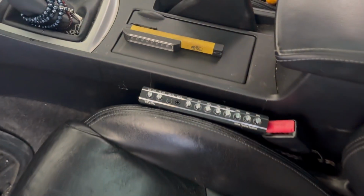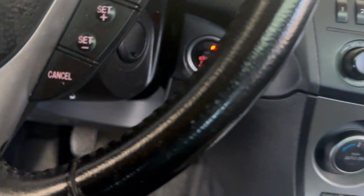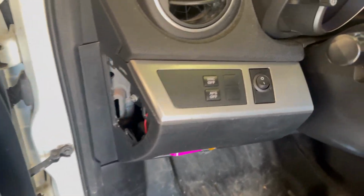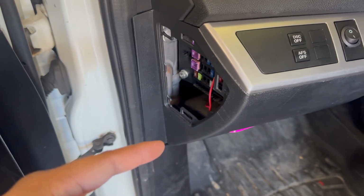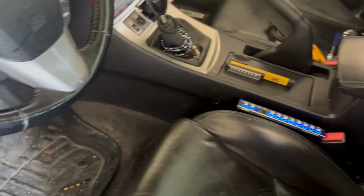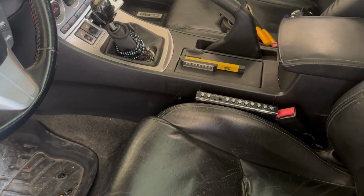And as you get into the back, pull up right here, I have the board sitting in there mocking it up. Finally got this wired in now. Turn the car in accessory mode, and right now it's off because I have it wired to a switch right here, which is wired to this fuse. It's to the remote turn on wire, so that goes all the way. Hit the switch and it turns on, off, on, and the whole system turns off and on by this switch now.